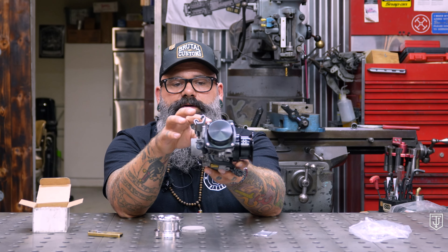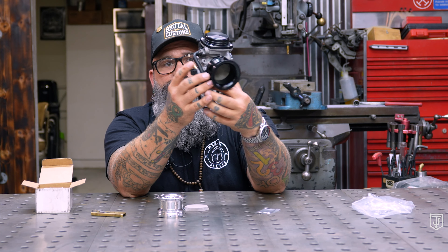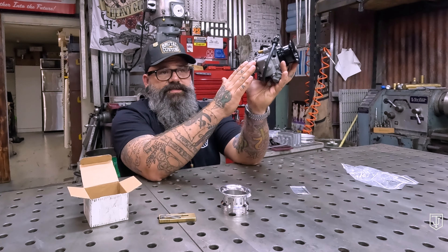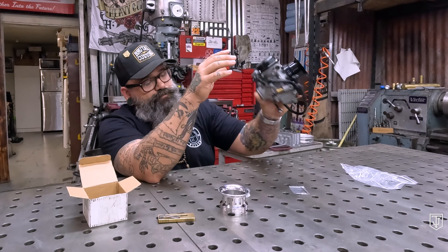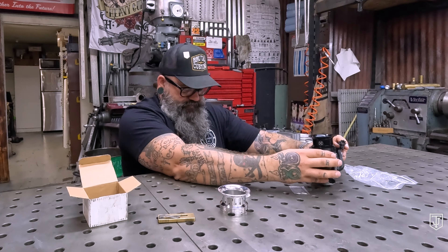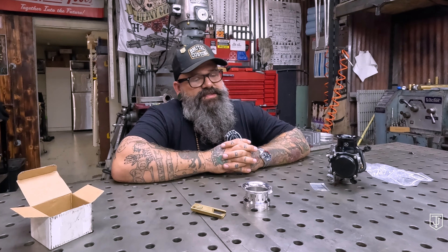If it's an old bike and you've never touched the carb, don't just get a performance tuning kit — I highly suggest the performance rebuild kit. It comes with stainless hardware for everything, an extended handle mixture screw, all the jets, the float bowl, everything you're going to need to soup this puppy up and get ready for your velocity stack.